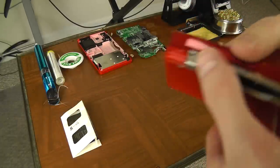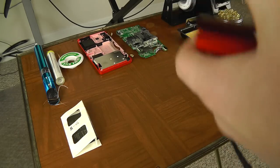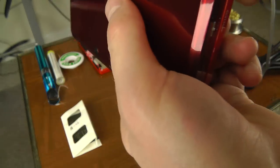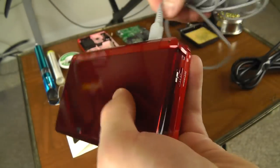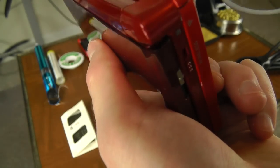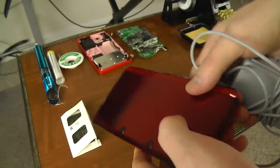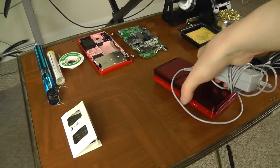Basically, when you plug in your charger and it doesn't charge your battery at all, the vast majority of times it's caused by people tripping over their charger cord while it's plugged in. What that does is it either bends two little pins that connect inside the charging port, or it actually breaks the charging port partly off of the motherboard.